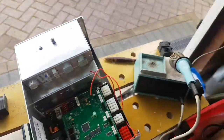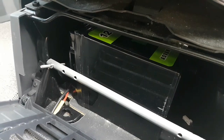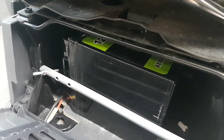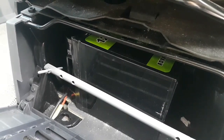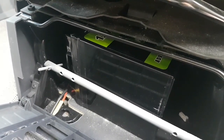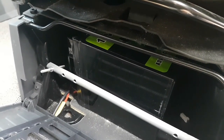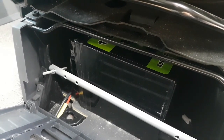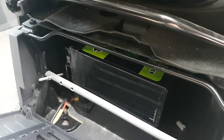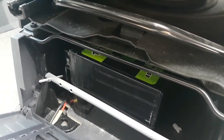In the passenger seat here we have a 100 amp hour KS100 model 12 volt lithium iron phosphate battery — that's what we're going to be charging. I've run this battery flat, which is important because it minimizes the internal DC resistance of the battery and it's therefore going to draw the maximum possible current it can from the alternator once the engine's running. The only thing limiting that current is the internal resistance of the battery itself, plus the internal resistance of the wiring through those devices and the distribution box.